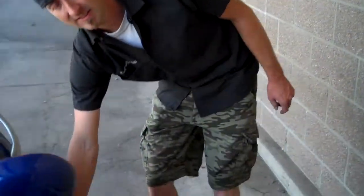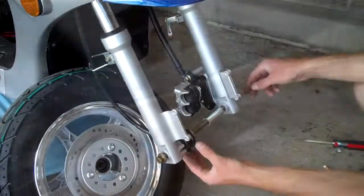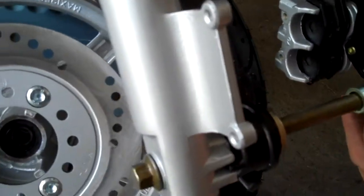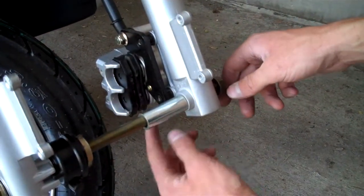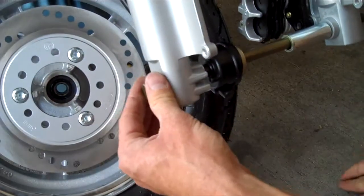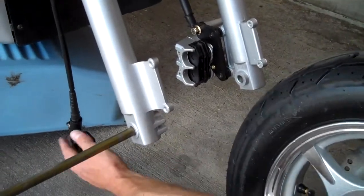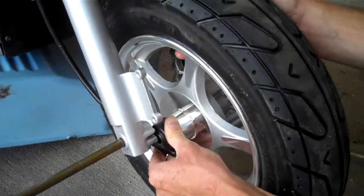Once you're done with that, come around to the center stand here. There's no front wheel on there, so you'll have to be very careful. Push this down — then the bike's off the ground. Note before you remove this how everything goes together, because this is the same way it's going to go back together. The speedometer has a notch here where it goes. Take note of that. The spacer goes on this side in the wheel. Be sure that you don't press the brakes or the pads will collapse — if they do, you're going to have to open these up with a screwdriver. Remove the axle like that. Put this on the side that it came off of. Set the axle in its hole so it stays there and get everything positioned.